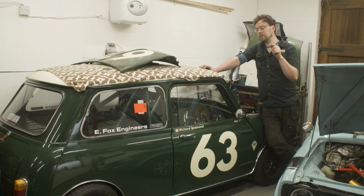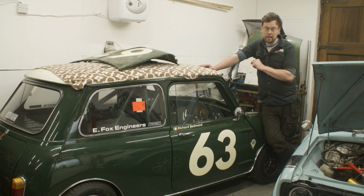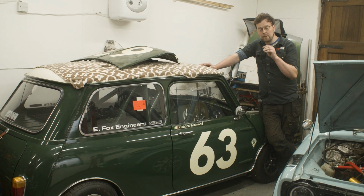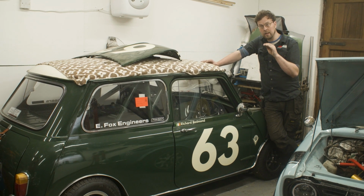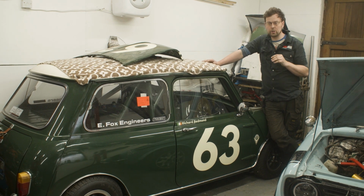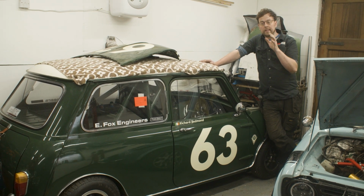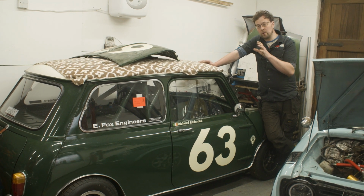So what I was able to do with that tool was put the needles that are in the carburetor at the moment in there, and I picked 2 needles richer and 1 needle leaner, and slightly different profiles throughout. That is going to give me a selection of a couple of needles that I can bring with me to the rolling road.